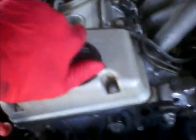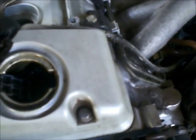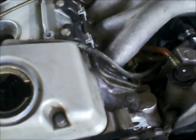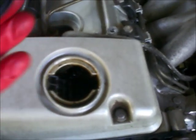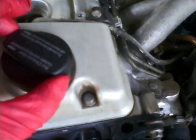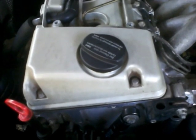To help the oil drain out, open the filler cap — there will be no vacuum in the engine and air can come in. Since you don't want anything falling inside the engine, I just leave it sitting on top of the opening like that, so any dust from the surroundings cannot enter the engine. That would be really bad. Next will be the oil filter.